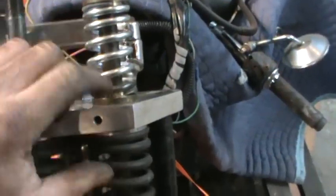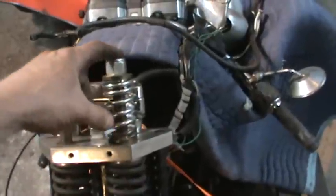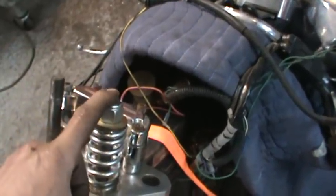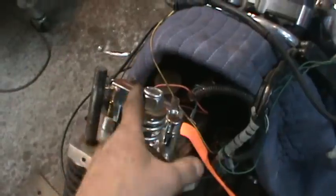This is going to slide up and down so it's a wear surface, so you need brass there. I couldn't find the right size nut in stainless at the local hardware store - their stuff only went up to half inch. These are 5/8-18 thread, so I have to try to find castle nuts for them, or else I'll dress them up in some fashion.